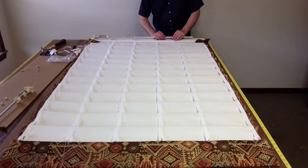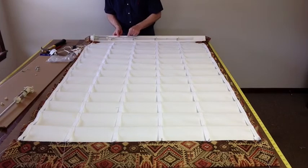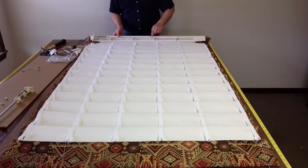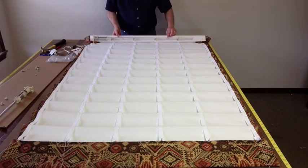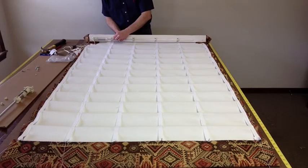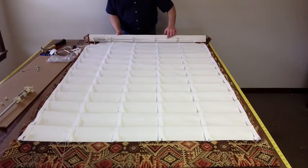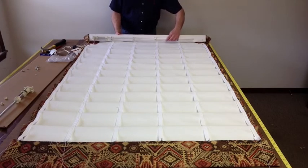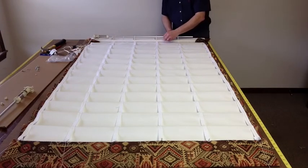All of these on the shift brackets are going to be mounted on this flute right here, and they're all going to line up just the way I have this one. These two are going to be in the same position on the same flute. You want to make sure that this bracket and each one of these are going to be in front of this. The brackets that are mounted underneath are just over a little bit to the screw eye side — you don't want it on the wrong side of the screw eye. The correct positioning is on this side of the screw eye.